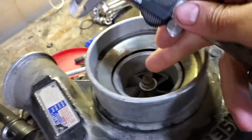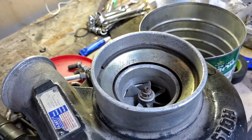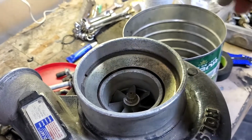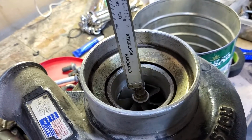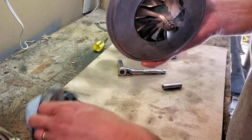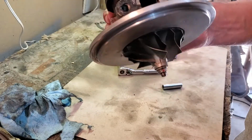Okay, and then when you do have it done and you're tightening the nut down, at least you get it right to where it was. It's a little something that I do because, like I said, rebuild places are far away, or balance places are far away. So mark it, and then measure it with a caliper so that you can reset it to where it was. And yeah, start going to town. Probably just put it on frame lap so I can concentrate, but those are the things that I try to start with before I get into it.